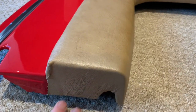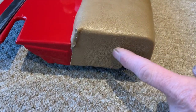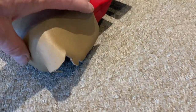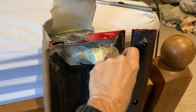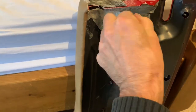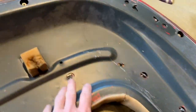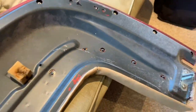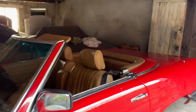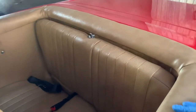You can basically stretch the vinyl round this corner with just one small join, and that join will be covered by the chrome trim. It's actually this visible face that has to be without any creases or marks. We're going to get the hairdryer on this piece and do the same again. Take the masking tape off first before sticking down — then it's just a matter of bending the vinyl over and stretching it, hopefully without too many creases. Once you've stuck the vinyl down to the best of your ability, don't forget to bend down these tabs, and on the plastic bits on the other side there are star clips you've got to click over.